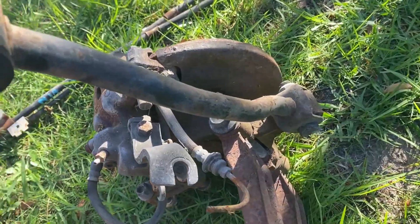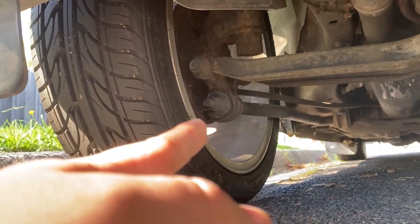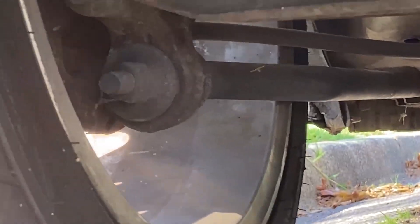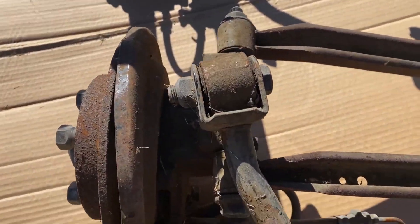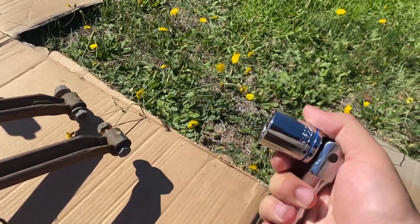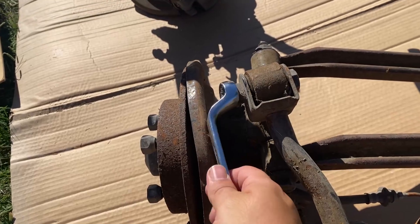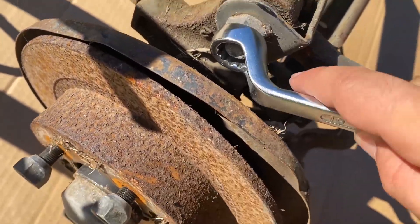I don't think I'll have to actually replace the rear crossmember at all. Looking at it... no, never mind - see that bottom bit right there? That goes right over there, so I'm going to have to line this up. It looks like it's going to be a direct fit. So to start off we're going to be taking off these bolts here. I've got my breaker bar and a 19 millimeter half-inch drive socket, and as backup a 19 millimeter ring spanner for the other side - if that fits. If not, I guess I'll have to go bigger, maybe 20.